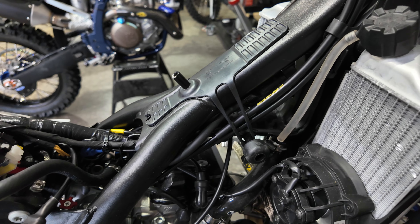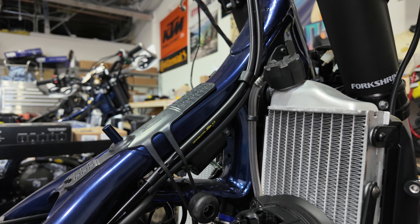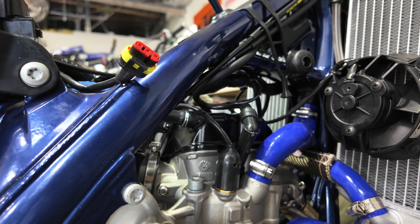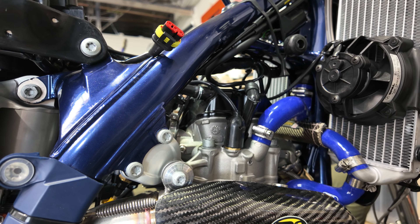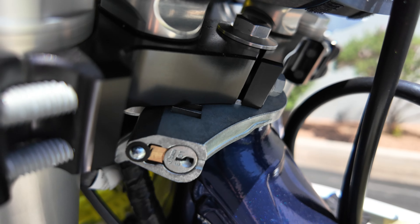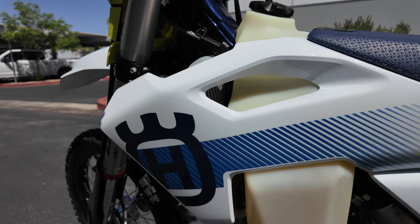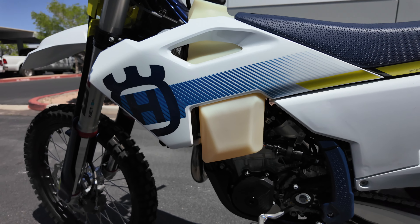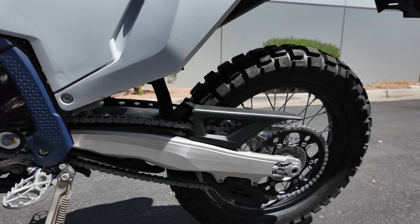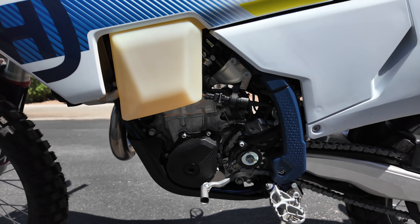They're trying to give that stability. If you look at motocross bikes, all the pro riders on all the bikes are doing their own bracing on the neck to stiffen it up. This frame is stiffer than previous generations. A lot of people don't like that and disagree with it, but for racing and more desert riding, this new generation is better. It still has flex — just not as much as the previous generation — and they're controlling where it flexes, making sure the neck, steering head, and everything is solid. It's a better frame, with better straight-line stability.